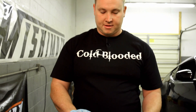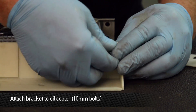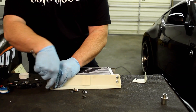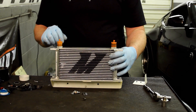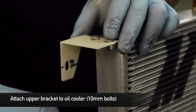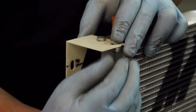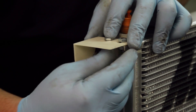This is what makes the 370Z direct fit oil cooler kit so great. Mishimoto has designed this bracket that bolts directly onto the car, making their oil cooler a direct fit for the 370Z. Before we get started, we're going to bolt the oil cooler right to the bracket using the supplied hardware, so we don't have to do it when it's on the car. Keep in mind the brackets used here today are prototypes — the final brackets supplied with your kit may look a little different and will be powder-coated metal. We'll also put the other bracket on and leave it loose until final installation.